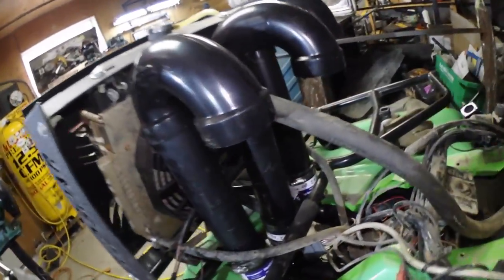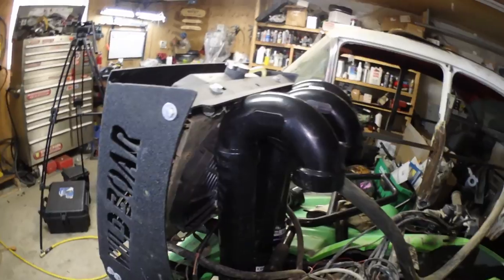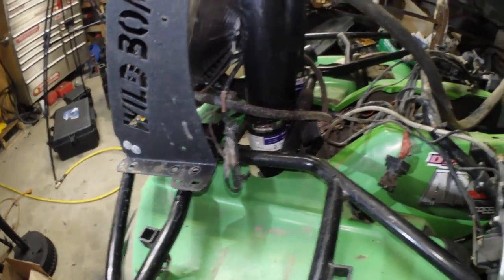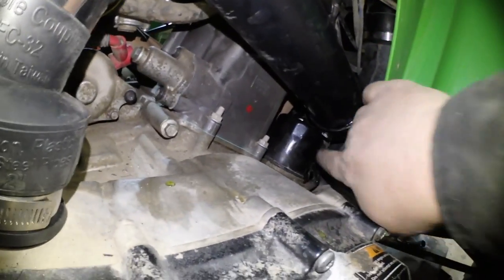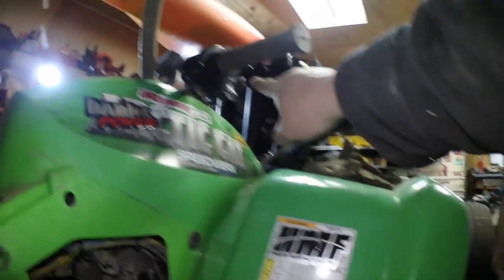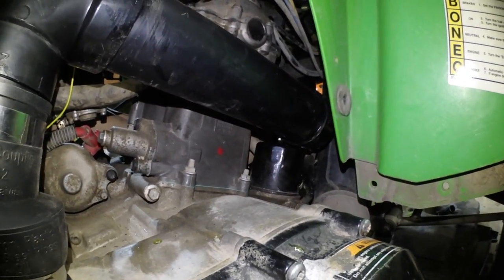This is where the shit show begins. Everything with the snorkel seemed to be worked out okay. Once it's mounted, it's going to put some pressure on those snorkels, but it does not seem to interfere with anything. That's why I got the flexible coupler at the bottom. I'm going to have to get a new hose because the hose on the bottom, because of the new routing, won't fit — so I need a longer one. And that oil filter is going to be a little bit of a pain in the ass to deal with now. But I learned that if you loosen off this coupling, you can lift the snorkel up top and pull it up enough that you can get an oil filter wrench on it.